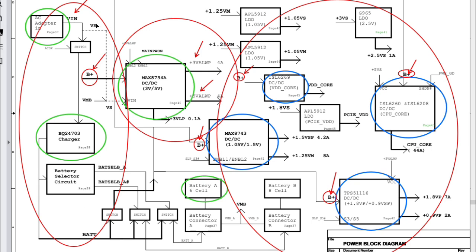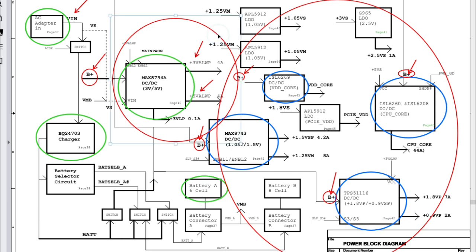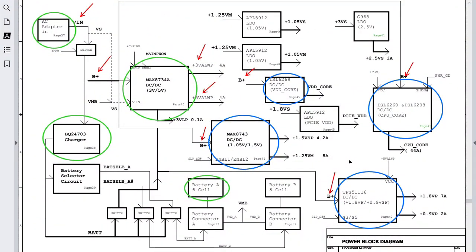So let's assume that this step is okay. Then we should go here — this is how you can diagnose very professionally any failed motherboard. Check this section here where we have three volt and five volt. After getting these two voltages, go down and check the secondary voltages where we have the CPU core, the voltages for the RAM, etc.